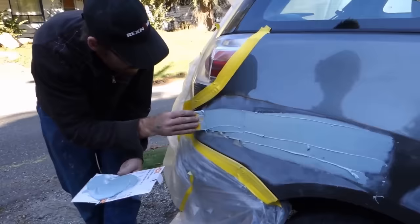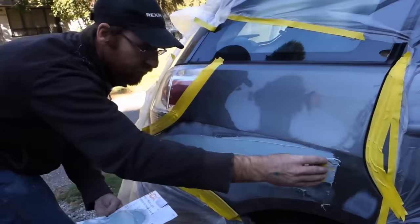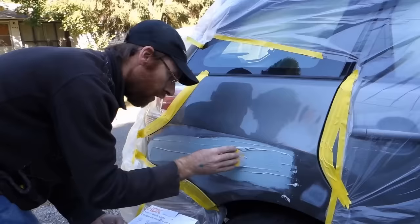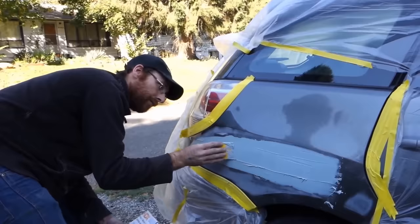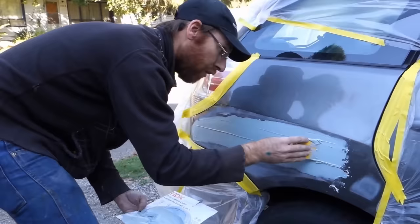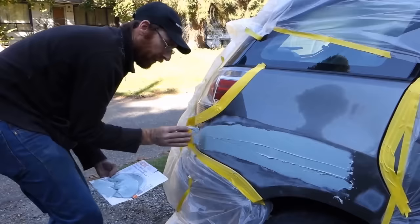That's because it uses a fiberglass resin. Almost all filler is that way, especially the hardened stuff, that has a hardener. And then there's some fillers that have actual strands of fiberglass in it. This is not that. So that's for patching up holes? Yeah, more where you're using it on fiberglass or you're concerned about water getting into it. Rust repairs are often done that way because it's more waterproof.